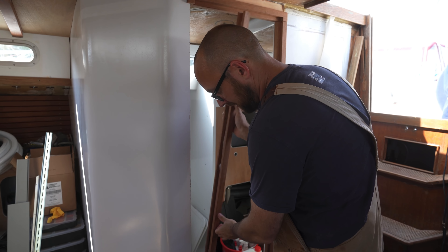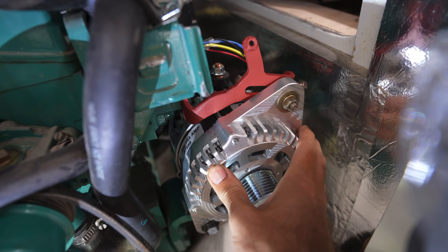Back to the alternator. After some fiddling around and emailing back and forth with Bruce, I decided to take the plunge and modify the existing tensioning arm — that involved cutting it in half, elongating it by 28 millimeters, and raising it by around 17 millimeters. My measurements were a little bit off, so Eva and I ended up going back and forth to the workshop four times before I was finally able to weld everything together. All praise the red doohickey! I spent about two hours figuring out the modifications and about four hours going back and forth — this was all supposed to be just a quick bolt-on situation, which seems to be about par for the boat projects here aboard Athena.